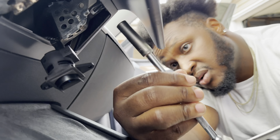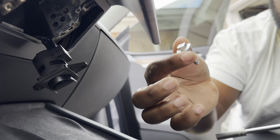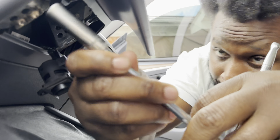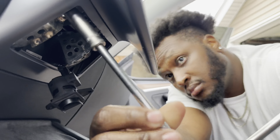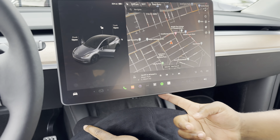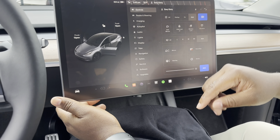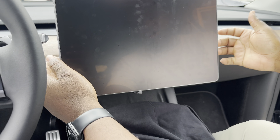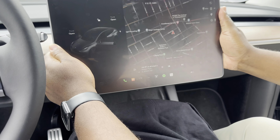You should be able to take the screws right out. This screw is actually holding the bracket mount — you're going to reuse these, so put them to the side. Once those two screws are out, the screen should be able to come out. The screen may keep turning on, so power it off again. You should be able to pull it straight out — don't force it; it should come right out.